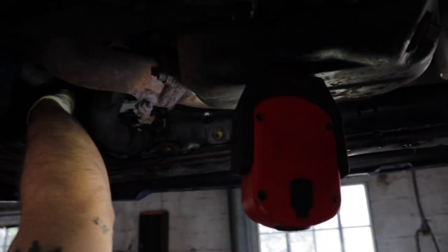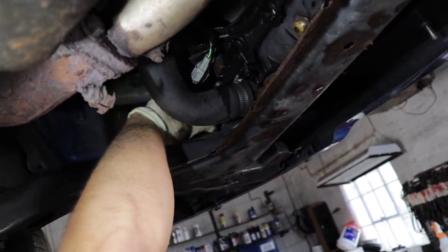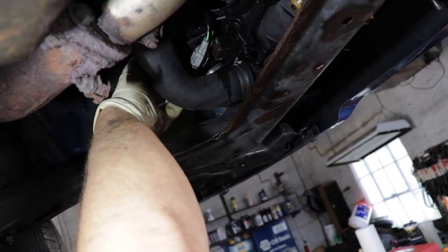The drain is a good way to keep it clean, but if you're trying to do it quickly, just drop the lower hose and let it come out. Generally the hose clamps are five-sixteenths to get them off.